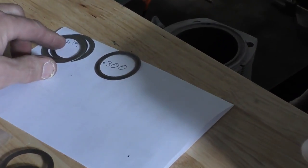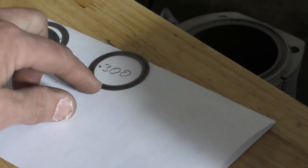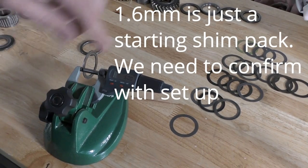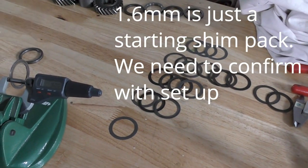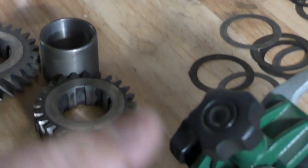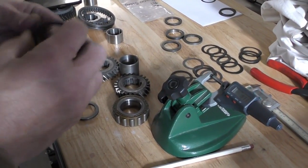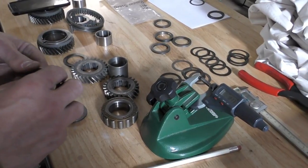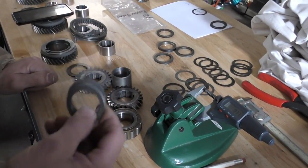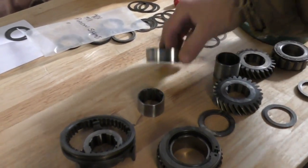Right now I have three shims at around 0.419 to 0.416 and one at 0.3. I've put together a shim pack that totals 1.6 millimeters — I have a selection of different pinion shim sizes and I just play around until I get the exact amount I need. This is the shim pack I'm going to use. We're going to assemble our pinion shaft, assemble it into the intermediate plate, set it up in the case, and validate it before we completely assemble the entire transmission. This is a new pinion bearing — the front pinion bearing — which comes with an outer sleeve that gets pressed into the transmission housing.